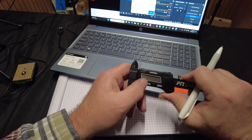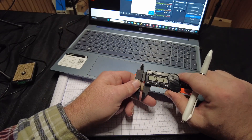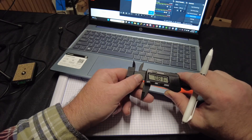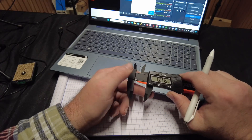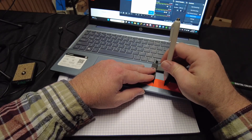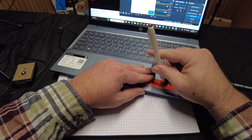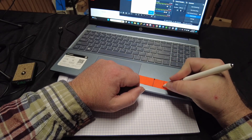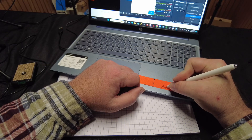We're going to measure this out in inches — we're going to measure out 0.88 inches. I'll take it from here and go right to there and be real close. So that right there is 15 degrees before top dead center.